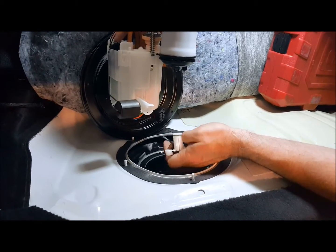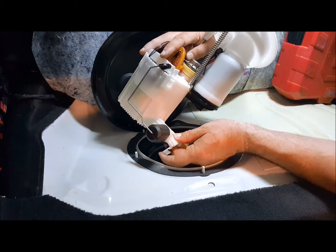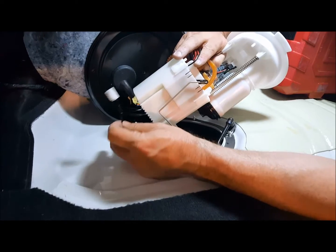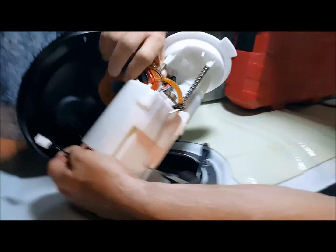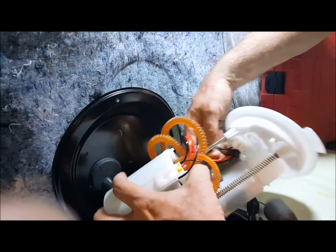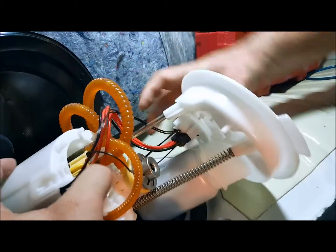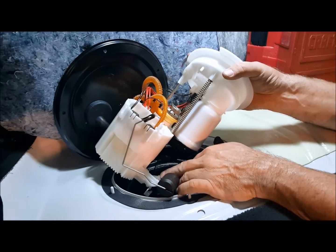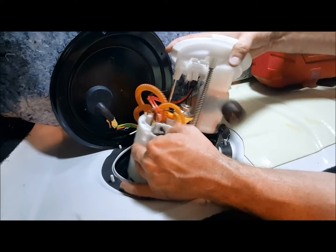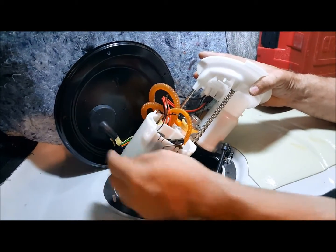Now that we have shown you how to remove the pump, we're going to go over how to put the pump assembly back in. Rotate and put the driver's side Venturi back in. The line that comes up for the driver's side float assembly comes up in between these two fuel lines and then plugs back into that stop location. Make sure that's all the way plugged in. When you go to put this back in place, make sure that the Venturi line is rotated 90 degrees or you won't get it past the lip of the tank. Go ahead and rotate that in.